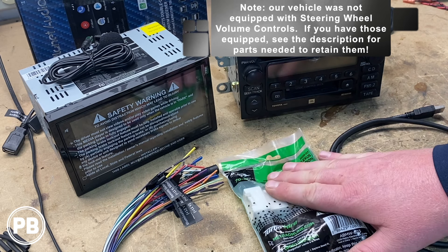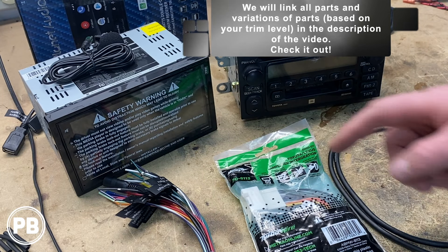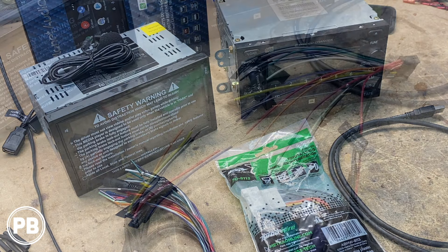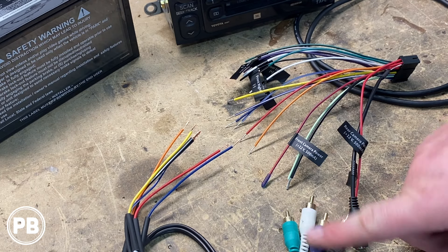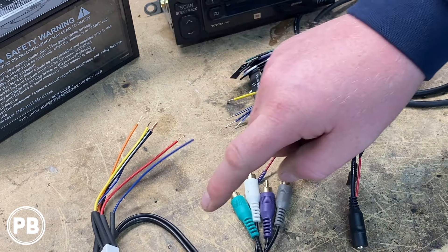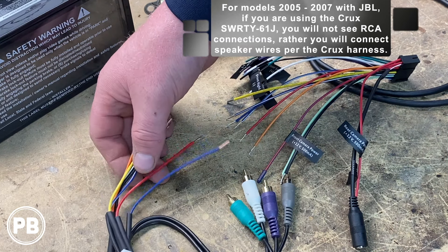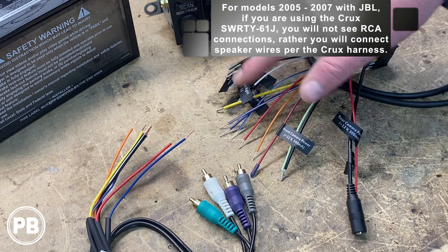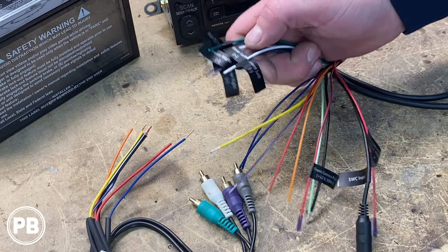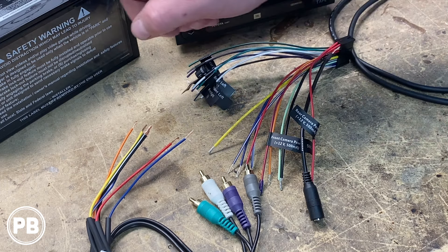The first thing we need to do is grab our harness and then grab the wiring harness of our aftermarket radio. We're going to start preparing them — stripping both ends — to get those soldered up color for color. We've prepped our harness and stripped both ends. Because we have the factory amplifier, we don't have to hook up any speaker wire from our aftermarket radio, because we need the low-line level inputs through the RCA outputs of the radio to supply the amplifier the signal it needs to play. So you won't see any speaker wires on this harness. On this end, same thing — we've stripped the ends. You'll notice all the speaker wires here; we just capped them off. We won't use them because we're using the JBL amplifier, not the built-in amplifier of the radio.